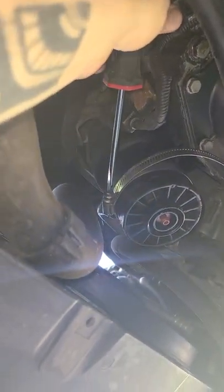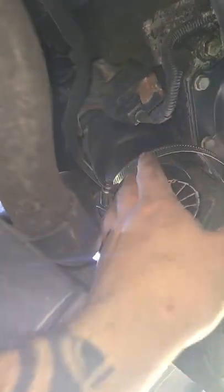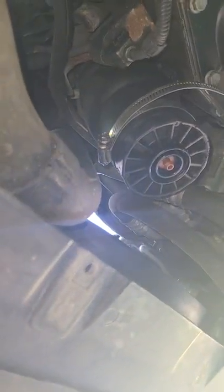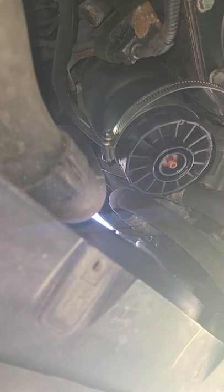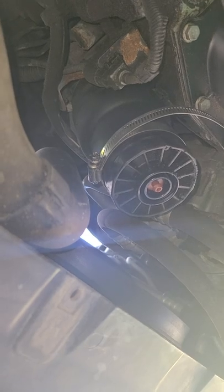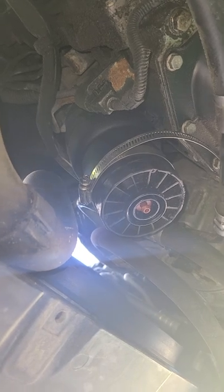I got my hammer and hammered the back of the flathead screwdriver, and it was just enough shock to loosen the filter just a little bit, so that I could then fit the wrench and be able to rotate the filter. Just a little bit of shock in order to get it dislodged, and then I was able to take it off the rest of the way. I was worried about damaging the filter if I kept just trying to wrench on it, so I figured this was a creative way to shock it and get it dislodged.